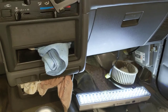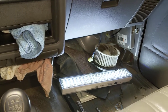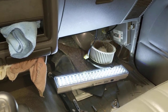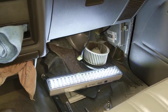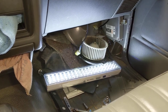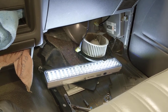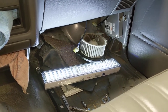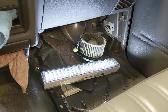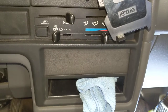I'm going to show you a few things about the heater blower motor. Mine was running out of balance and it was only running on one speed. I had a suspicion why it was out of balance, but the speed was a different issue. The truck had some issues with mice making nests in it, and it had acorns in the blower cage, which was most of the reason it was out of balance. I took the acorns out and plugged it in — it's still a little bit out of balance but I'm not going to bother with it. Also it was only running on one speed. There's a heater blower motor resistor which some people say to check, but that was good on this truck, and what it turned out to be was the switch.